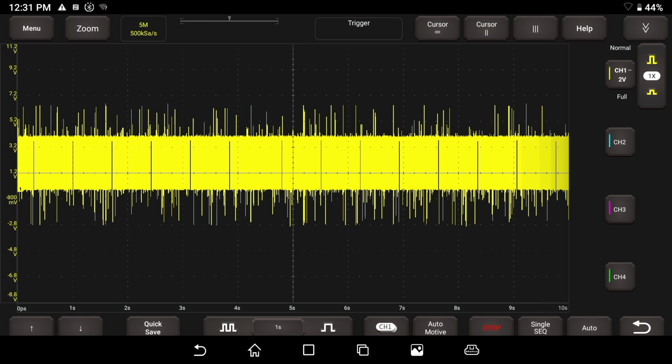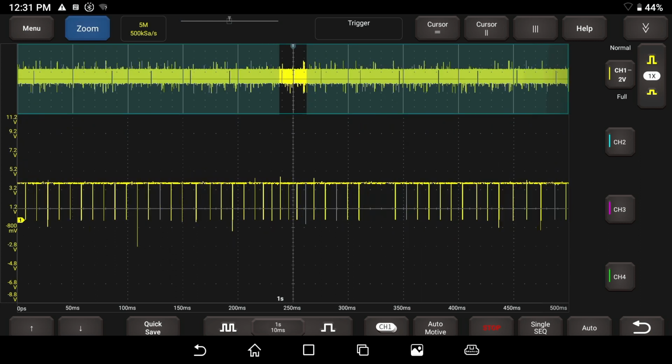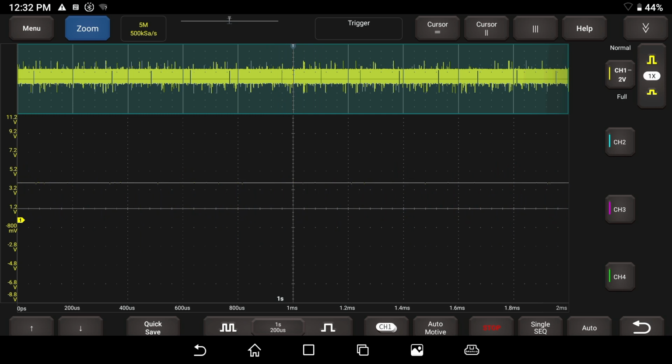And I'm going to go ahead and hit my zoom button, and I'm going to get zoomed in here, and let's take a look at what we really have. Let's get in here, zoom tight. And I want you to see we have a very clean pattern. This is awesome. This is a good capture. I'm happy with this. Very good quality here. Let me go ahead and find my other rulers. So you can see we're measuring a pattern. It's what, 54 microseconds is our time there. Pretty darn good sample rate for that.